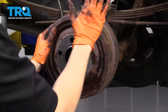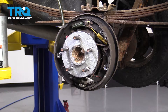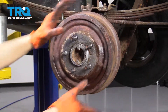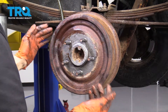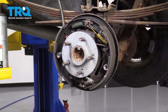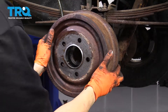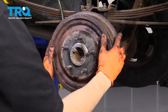See, that's a little bit too much. To back it off, pull back on this retainer and turn it the opposite way. A lot of times this is a trial and error process. You can hear them scraping — that's exactly what you want. I'm going to expand the shoes one more notch. Okay, I think I'm just going to leave them exactly like that. The drum still slides on no problem, and I have minimal friction. Perfect.